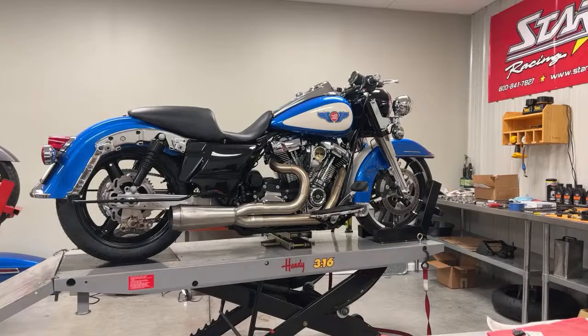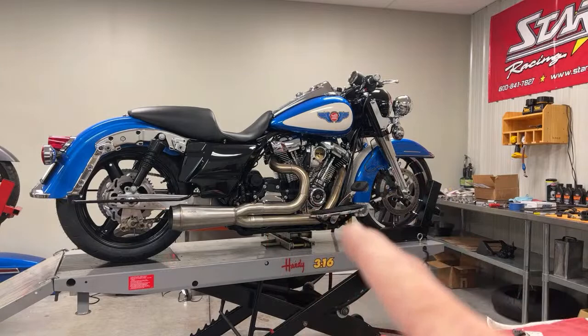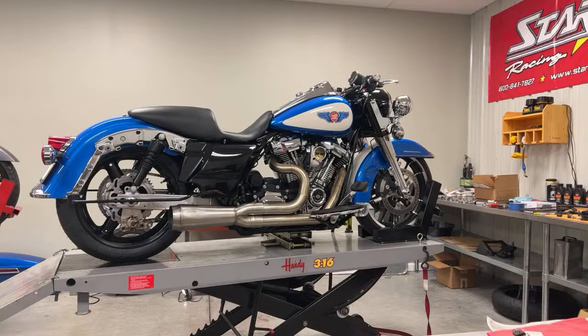In 2020, they came out with a new oil pump that has a better scavenge stage than it has a pressure stage. And there's a lot of people that are reading this that don't understand what's happening with this sumping. And I'm giving you an opinion. This is not the facts as proven by an engineer or some independent or dependent laboratory, where Harley-Davidson's trying to cover their bases and do the best they can with this bad issue they have.